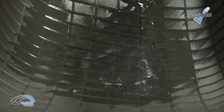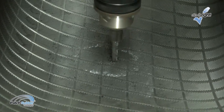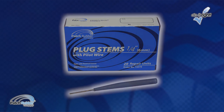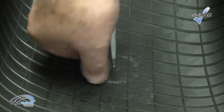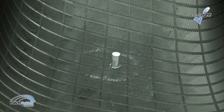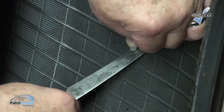Clean the inner liner area around the injury with patch rubber cleaner fluid and a scraper. Using a low-speed drill, maximum 1200 RPM, and the proper carbide cutter, ream the injury following the angle of penetration three times each from both the inside and the outside of the tire. Make sure you're using proper eye protection. Use a pilot wire plug stem to fill the injury and keep moisture from seeping into the tire. Coat the entire plug with patch rubber fast-dry self-vulcanizing cement. While the cement is still wet, push the guide wire through the injury channel from the inside of the tire. Using pliers to grasp the rubber portion of the stem, steadily pull it until one-half inch of the plug stem is exposed outside the tire. Using a flexible knife, cut the plug on the inside of the tire one-eighth inch above the inner liner.